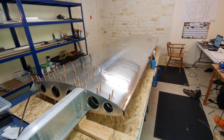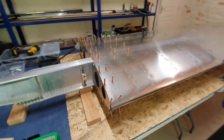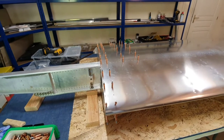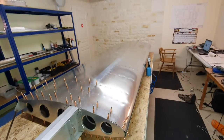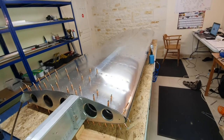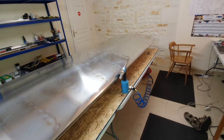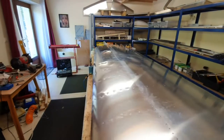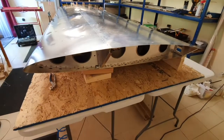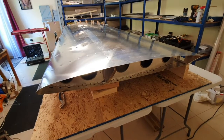All the rivets are now in the top side of the front skin, except the ones for the wing doubler which I've left out for now — we'll put those in when we fit the wing to the fuselage. All went okay; I had one rivet that wasn't very good so I took it out and redid it, and it's fine. The skin is sitting down nicely on the ribs and I'm quite happy with that. Next thing to do is to turn it over and put the wingtip on.